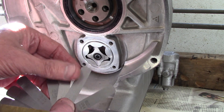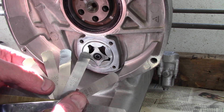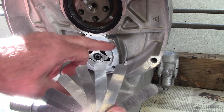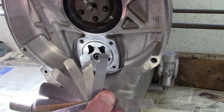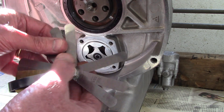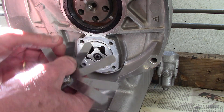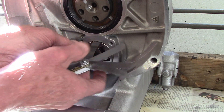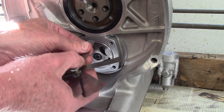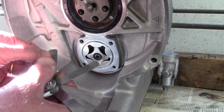The ranges are in millimeters, but my feeler gauges are in thousandths of an inch — though the corresponding millimeters are printed underneath. For instance, where I'm looking at the clearance between the outer body of the oil pump and the outer rotor, that distance is from 0.1 millimeters to 0.171. So I pick a set of gauges that bracket that range — like 0.102, 0.127, etc. — and insert them in. If it slides easily I go up to the next one, and when it gets really tight, I call that the right measurement.